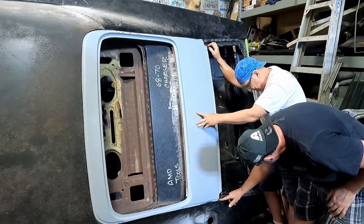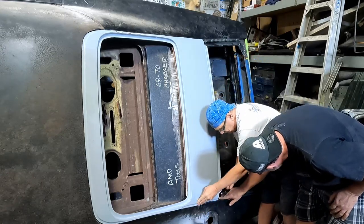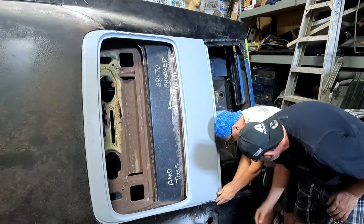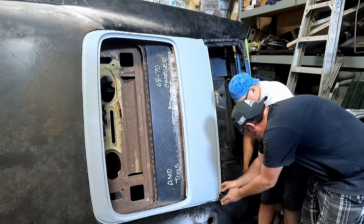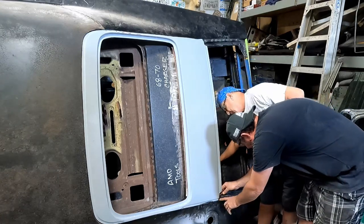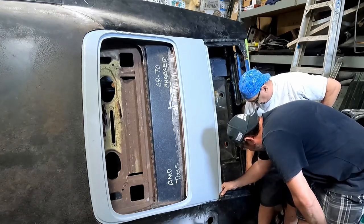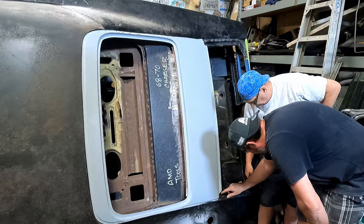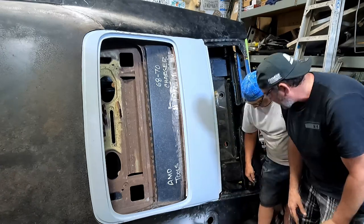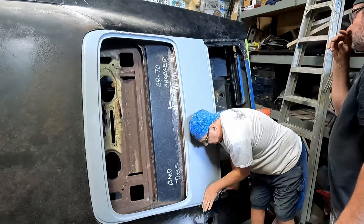I can stitch, like take a piece of metal and then butt it to this. Yeah, that actually needs to come. No, it doesn't. Well, when we weld in that support beam, that's gonna take care of that. And then I can tack weld when we clean up these gutters. I can tack weld just a little strip that marries directly to that and to this. That way it completes that, since we took a half inch out too much. I think that's gonna be good.